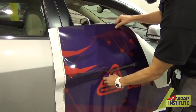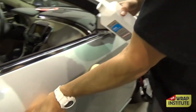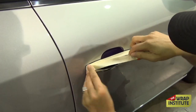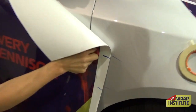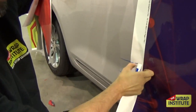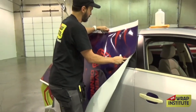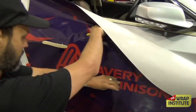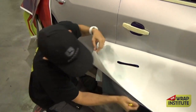I cheat a little and shift the panel so the door handle is mostly in the purple area so I don't have to register it. Then I do an inlay — there's a video on inlays in this series, so don't panic. Once the inlay is done, I masking-tape it, then masking-tape the chrome at the top of the molding. I line everything up to the water-soluble pen marks — I can't say enough about those for creating speed and quality. Then I use the water-soluble pen to trace out the door handle, and I'll show two different ways to cut it out.